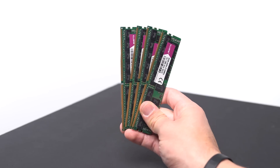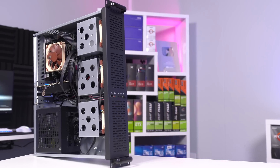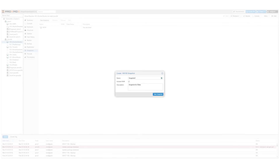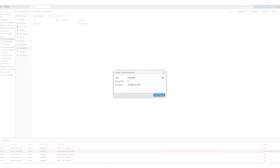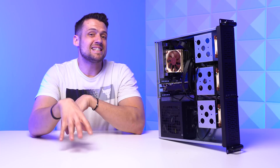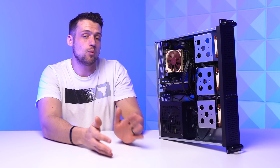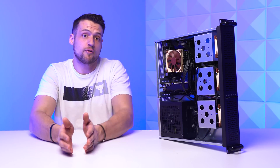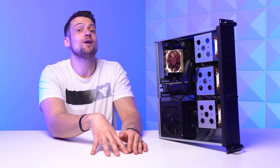The first thing I needed to ensure was that I got a system that allowed for 128GB of RAM, so that was pretty easy. I also needed to add bigger SSDs to my ZFS pool, which hosts all the virtual machines. Along with virtual machines, ZFS snapshots take up a ton of storage as well. Basically, you can take a snapshot of a virtual machine at its exact point in time and roll back to that point whenever you want. This is super handy during a critical OS update or server maintenance — you take a snapshot before config changes, and if you mess anything up, you can roll back like it never happened. This has saved my butt so many times.